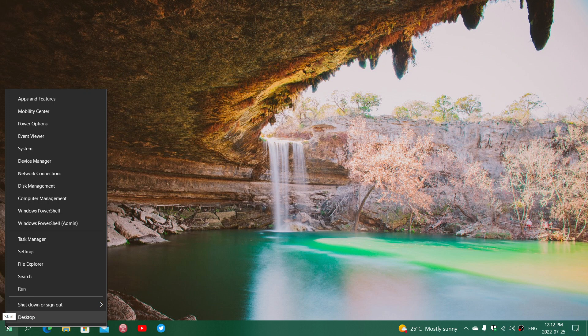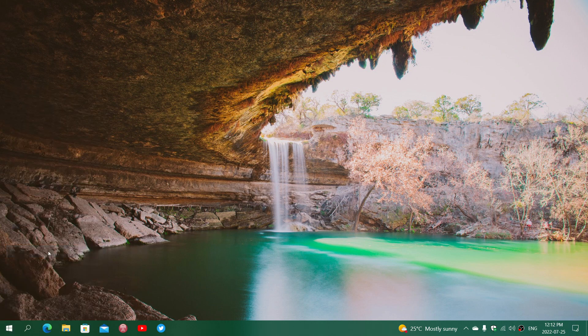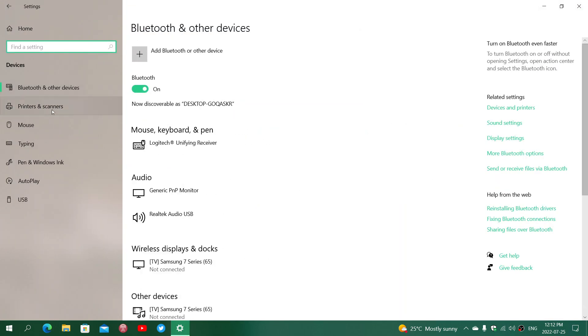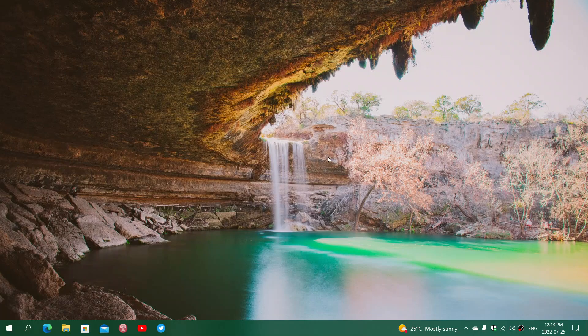Normally what should happen is that when you do that, it's going to detect and reinstall the printing device in your settings. You should come back and see that there's only one available, and once that is done your USB printer should start working again. It's really a question of a duplicate driver or a duplicate of the driver settings in Windows, and so it selects the wrong one when you try to print.